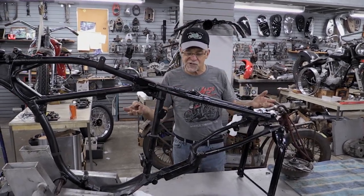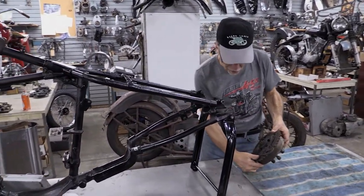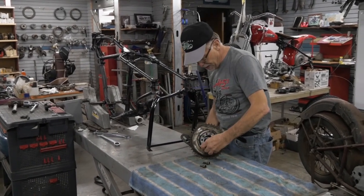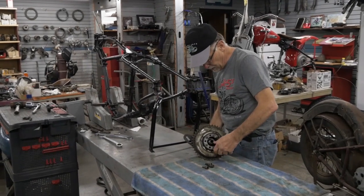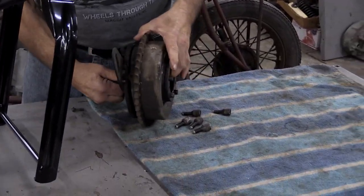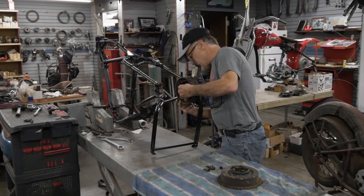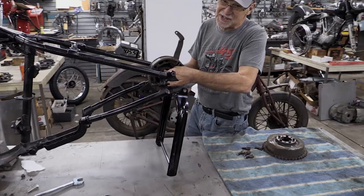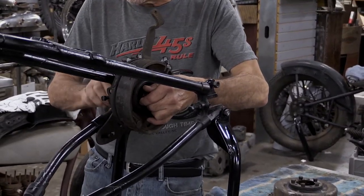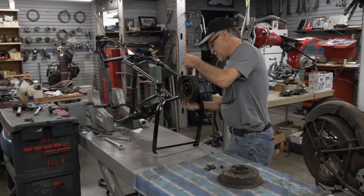What I'm going to do right now is show you how to assemble a WR. It's a steel frame with cast steel forgings. A lot of the parts on the WR are road model parts — parts you could put on an Army WLA or any of the bikes they built all the way up to 1952. The 45 is the longest continuously produced Harley they ever built: 1929 to 1952. It's really not known how many 45s were built, although they built 66,000 in World War II for the military. The WRs are fairly accountable — it's pretty well thought that about 600 WRs were made from 1941 all the way to 1952.